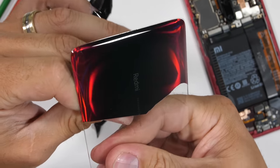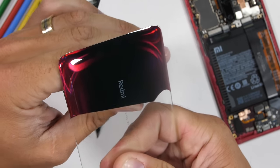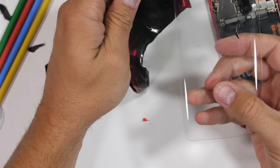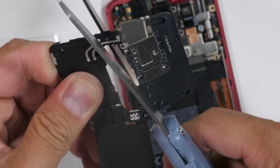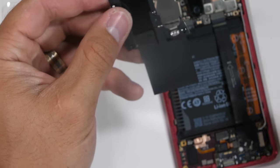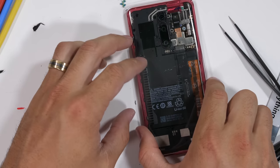I'm being very careful not to flex the glass as I peel it off though, because glass is glass and glass can break. Some of the internal black plastics are important. You can see the silver metallic antenna lines, so I'll keep those and the connectors for the NFC pad. I'll also keep the lower loudspeaker with its contact pads. Once those are cut, the clear glass can be stuck back into place.